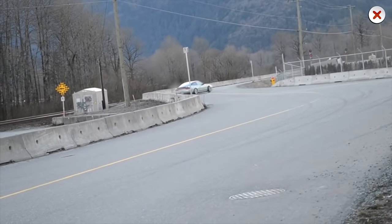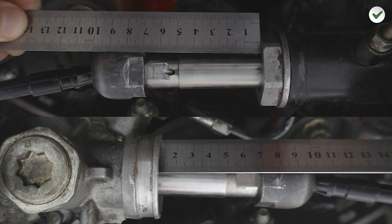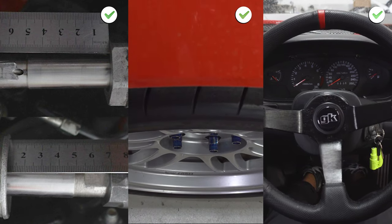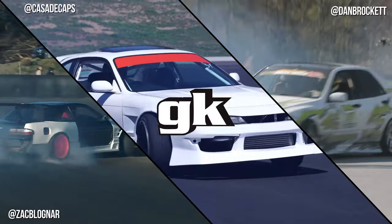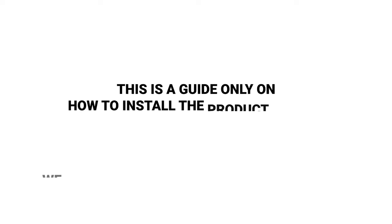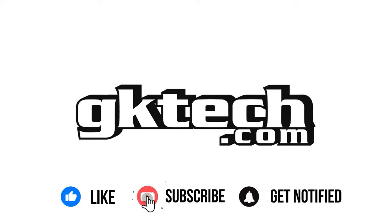In conclusion, this step gets overlooked often and will cause you to have a horrible day at the track or make your U-turns on the street uneven and frustrating. Just make sure that the rack has even spacing on each side, that the wheels are straight, and that your steering wheel isn't pointed off to one side. If you can't handle these steps, have a pro do it, or reach out to us with any questions via email. This has been Officer Dan, Johnny Caps, and straight Zach with another GK Tech how-to. Peace.